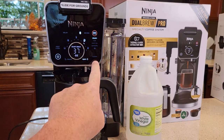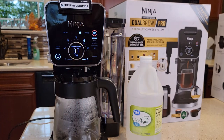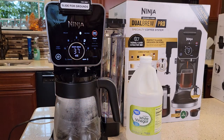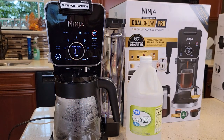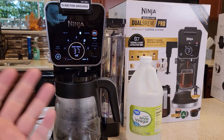You may have noticed your clean light comes on, or it may display the words 'clean.' If your clean light comes on, that's just letting you know it's time to clean the inside. But if the display says 'clean,' that means it's really built up with minerals and your machine really needs cleaned — it could stop working or stop mid-cycle until you clean it.